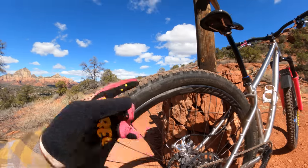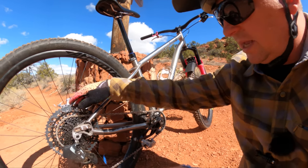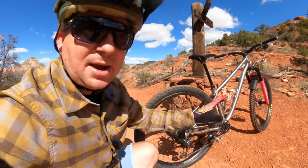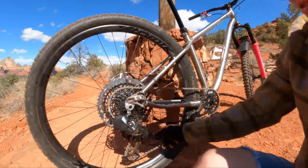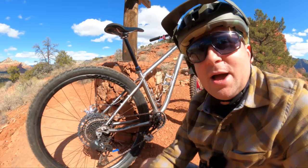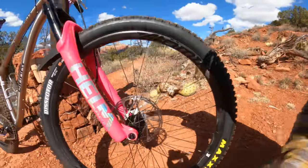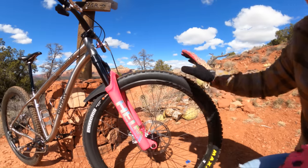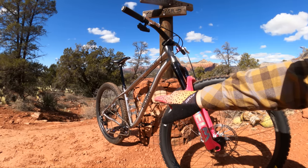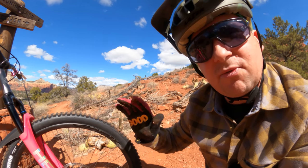These wheels have a 29mm internal. Rather than compare weights online, I decided to weigh my entire wheels with tires, rotor, and cassette. Wheels are a lot heavier than I thought — I've got over 10 pounds of just wheels and tires on this bike. The rear weighed 6.0 pounds, that's 2,720 grams. The front came in at 4.94 pounds or 2,240 grams with a 200mm rotor. I'm running a Dissector 29x2.4 3C on the front and a Specialized Ground Control 2.3 Grid casing in the rear. That's just the baseline — let's go see what they ride like on the same exact trail.